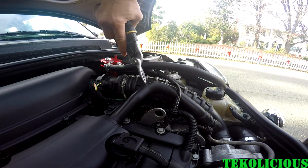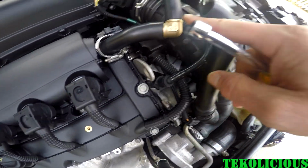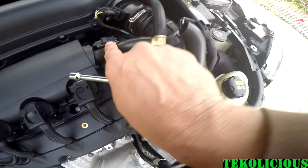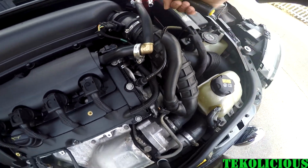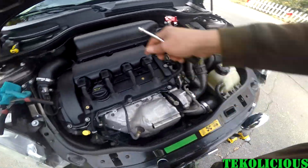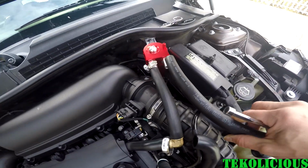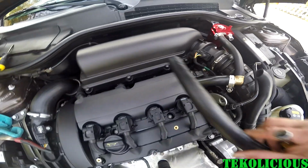Now, if you buy plenty of hose, that's not going to make a difference. I bought pretty much the exact amount of hose I needed. So I've got the 90 in there. It looks pretty good. I've cut both sides. I'm going to put some straps on there. So now just take the remaining hose and place it up on the oil catch can and figure out what your lengths are going to be. Cut it and then add the connectors, same as before. Let's do it.